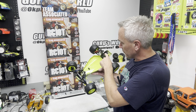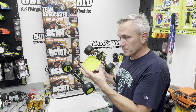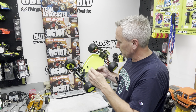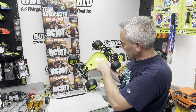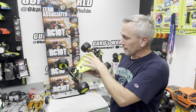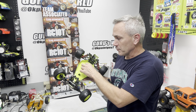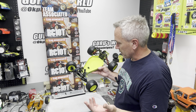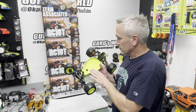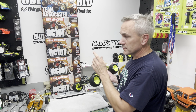I mentioned in that video about running maybe a carbon fiber vinyl inside so if we ever took the electronics out we could just peel it out and wouldn't take a chance of scratching anything. Still may do that, but there was no need to do it prior to bolting the front nose plate on — if there was vinyl underneath, sandwiching it tight would cause it to bubble up at the edges. So we'll just make a template out of paper in the shape of the nose plate and lay it in there and we'll be perfectly fine. That'll give us some protection for wear and tear from the battery moving around. Powder coat will scratch too — it's very durable but it'll eventually wear off.